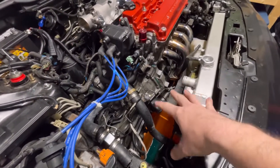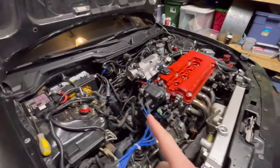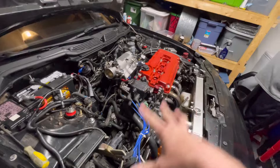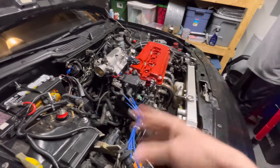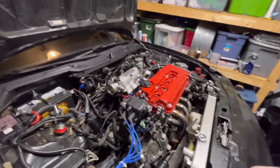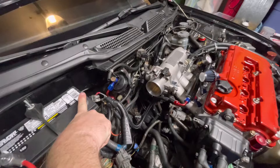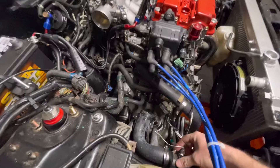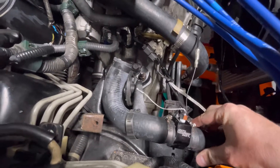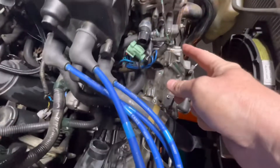The car's been sitting for about a week so oil and coolant should be pretty much all drained down and not through the motor, so we're good there. We disconnected the battery, got the cold air intake out. This radiator hose is the upper one with the coolant temp sensor - we're going to have to rewire this because the connector came out.